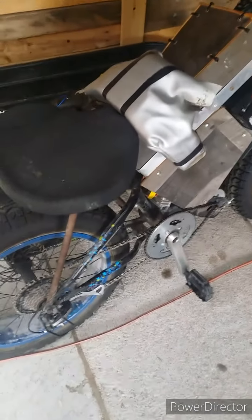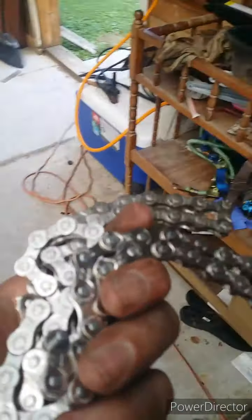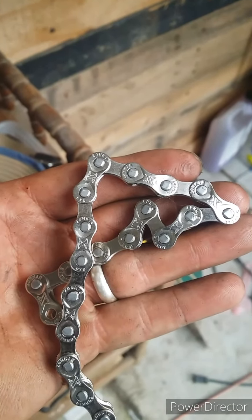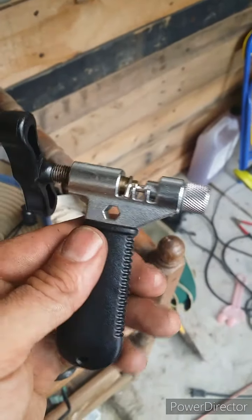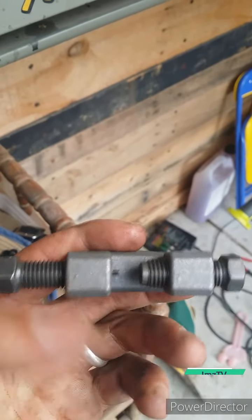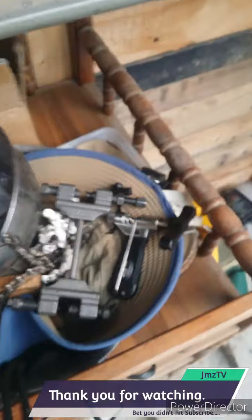Alright, we've got the new chain on. It is a Zonkey. We have got a 24-tooth front, which gives us an 11.44 to 1 gear ratio — just a little bit on the faster side than the other one, which means we can't pull a hill as good but should be able to go on a flat road faster. Still don't think we'll be able to shift with this stupid derailleur. Here's the old chain and a piece of the new chain. This one seems like it's going to be a better chain. And here's the new chain tool — it's an Atlan, got it from Amazon, real cheap, did the job real fast. This is the old one; I broke both of the pins on it. Oh well. Let's go ride this thing.